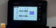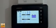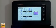Now you'll see your battery's fully charged. It's got 13.6 volts. That's normal. That's where it should be. That's a healthy battery. Up here it says AC connected in small letters. That's telling you that I've plugged in the mains power outside. When the mains power is plugged in, it is normal to see the solar panel read 0. The mains power overrides that panel.